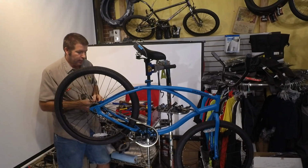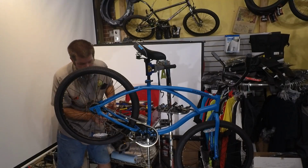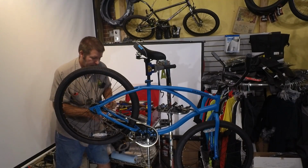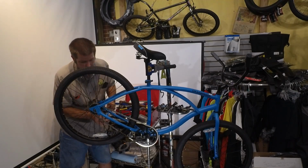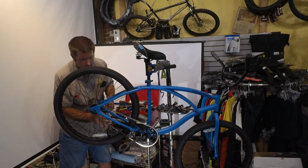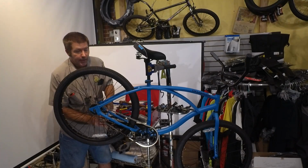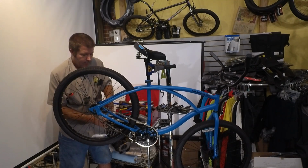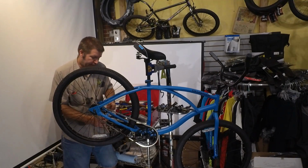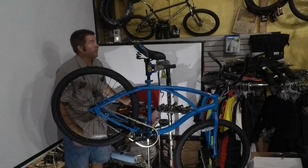Super important that you not forget this brake band. So many people have messed up their frames and their hubs by not tightening this. If this bolt were to fall out and you were to hit the brake, what happens is that brake arm starts to turn, and then it'll mess up the hub. It'll break the bearing adjustments free. The hub can over tighten. It could get loose. All sorts of things can happen.